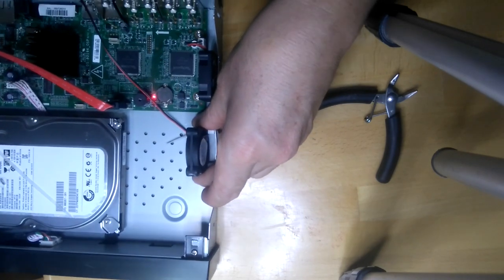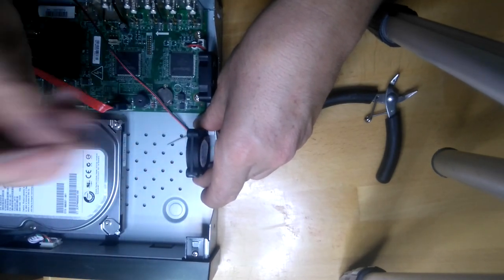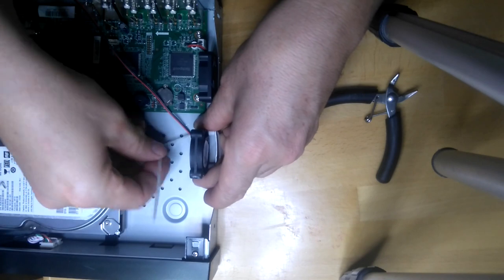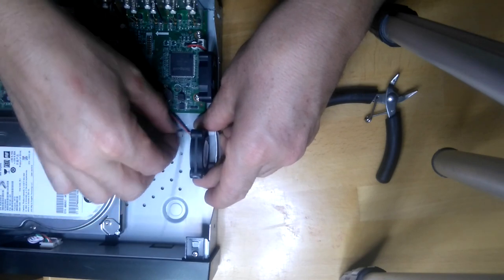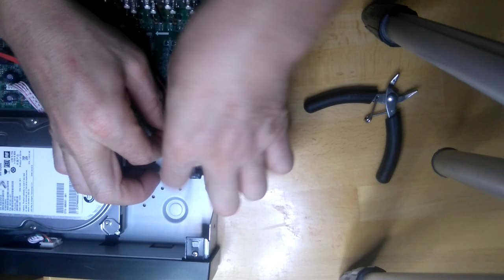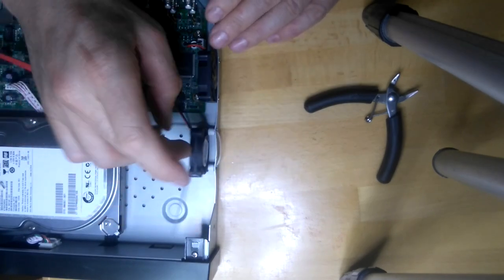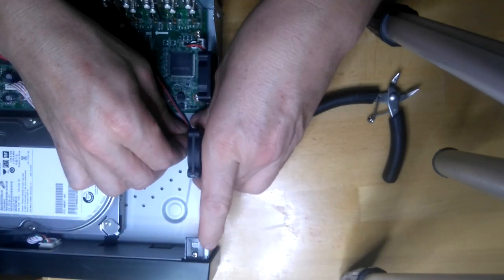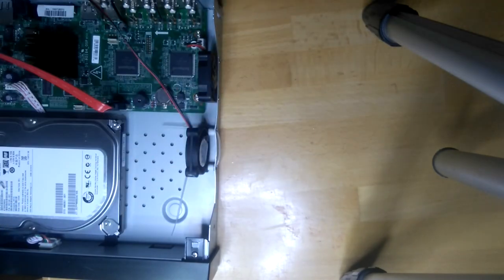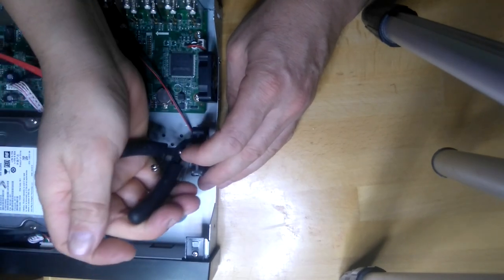I'm going to cut that noise first, to stop the fan. Right. It's peace and quiet now. With the other cable tie head, we put it here just to lock the fan all together. I'm just going to push it in and lock the fan. Now the fan is not contacting the metal chassis, and I just cut the excess piece of the cable ties.